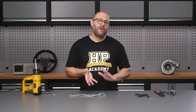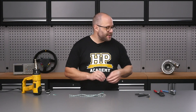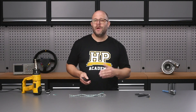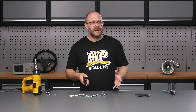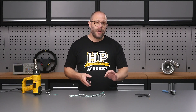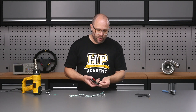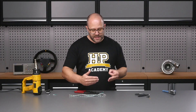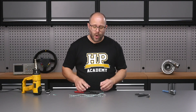We've got all our wiring prepped now. I'm going to get one of my open barrel splices installed into my crimp tool. I've used 22 gauge TXL wire here. 22 gauge TXL wire has an individual CMA — circular mil area, the actual area of the copper conductor strands — of 700. So all up we've got 2800 CMA of copper to crimp together, and that's well within the range of the open barrel terminals I'm using here.